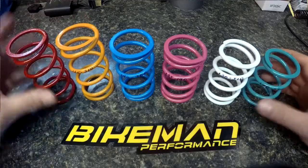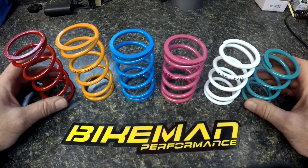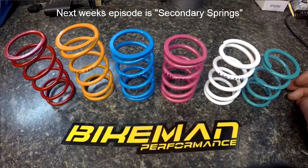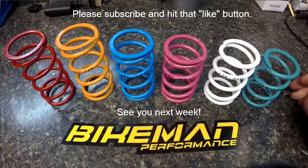That's a brief glimpse into primary clutch springs. They do work in complete conjunction with your primary weights, so it's kind of a matched set. Don't try to do all your clutching with just your primary spring — the right way to do it is use weights and spring together. We're going to get into secondary springs next week, so stay tuned for more videos. Subscribe to our channel and like our page. Thanks.